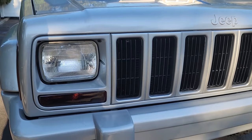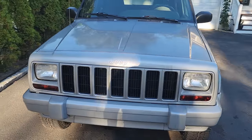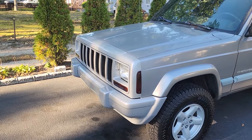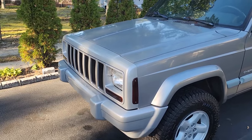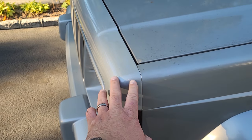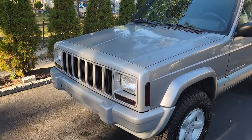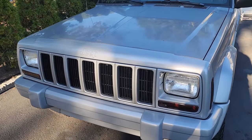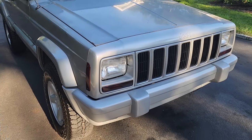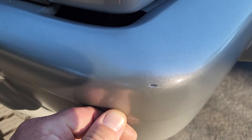My first paint job wasn't too good because I accidentally used the wrong color — bright silver metallic — and obviously the XJs of this year are Silverstone Metallic, so we had a color discrepancy. When I repainted it with the right paint code, the paint I got didn't exactly match anyway. It's slightly different — hopefully the dark is just dirt and it'll buff out. I got the header panel squared away, touched up the grille and the middle section that was scuffed. Just a little Bondo, a lot of filler primer, a couple coats of paint, and some clear — this is Rustoleum clear coat from Home Depot. Always gets the job done.